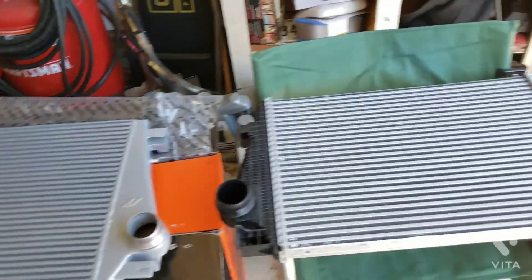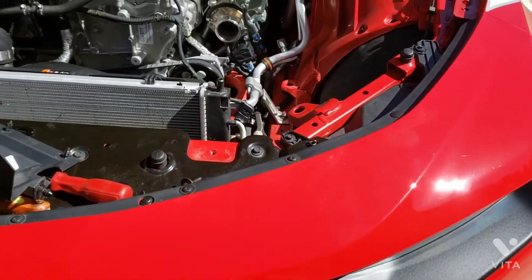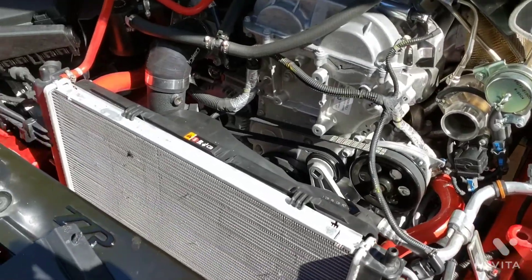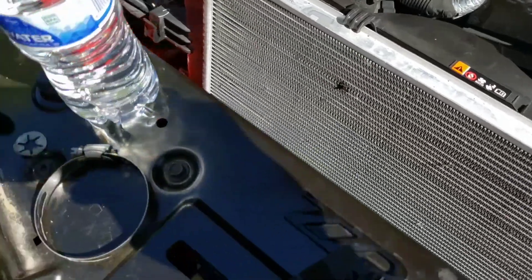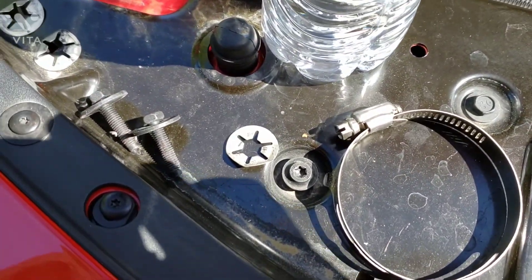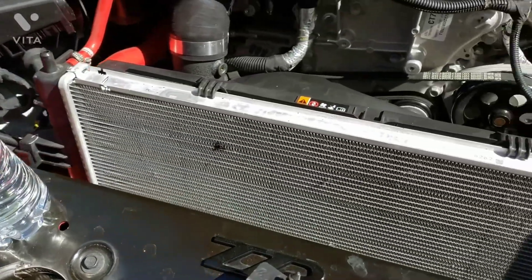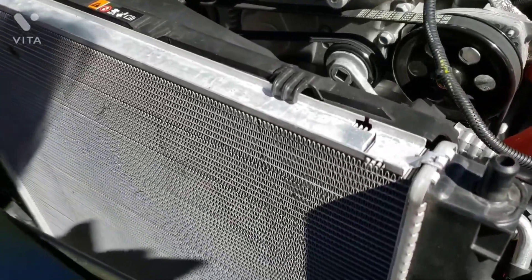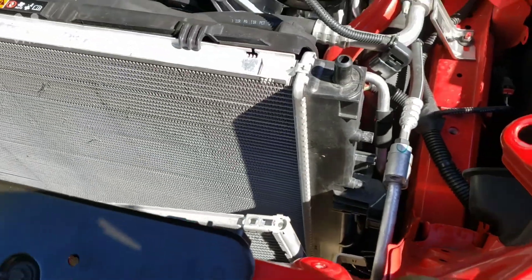Here's the car. A lot of guys take off the front bumper, but I'm kind of doing this alone so I didn't want to chance messing up the bumper. I just took out the radiator shroud — there's a bunch of these little clips I've got to straighten out and put back on — but you pop those off, there are a few bolts here and there, and it just kind of lifts out from between the condenser and the radiator. I've got the bottom splash pan off too. This is definitely the way I prefer.